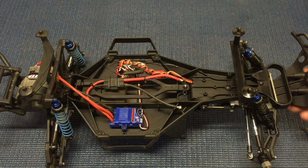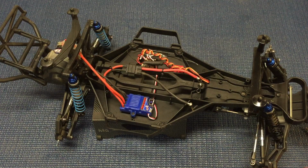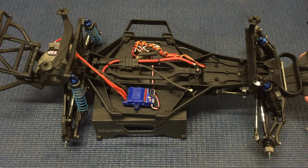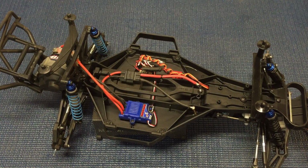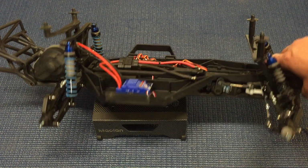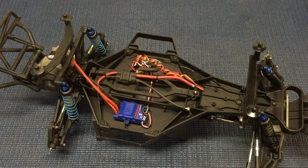Your car can't just rail around the corners. When you're going around a corner, you can only basically get as much speed as what the traction will provide. Beyond that, you're either going to slide or your truck's going to roll. So rolling a little bit will in general provide a little more traction on that particular corner it's rolling to. Now, if you roll too much, you can obviously traction roll, but you also can overload that one particular wheel. So you really need the right amount of roll for the amount of traction you have and the tuning or behavior you're looking for in a vehicle.